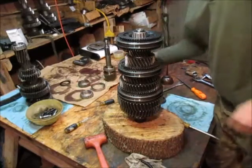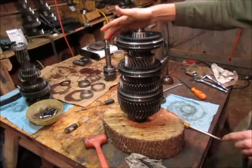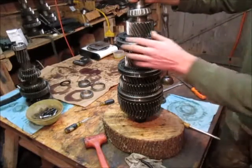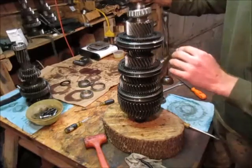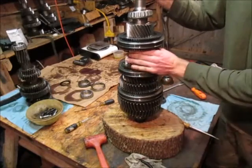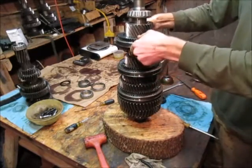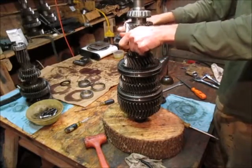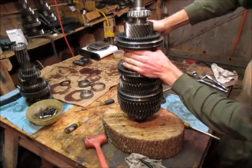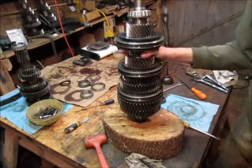Put the snap ring on - I'm not going to do that just yet because I want to look at it a little further on sixth, just to be able to look at it. But yeah, just throw the snap ring on. And then the input shaft goes on. I don't think there's any particular orientation as far as the input shaft goes. There we have it. And then it shifts good - shifted into sixth, good. Shifted into fifth, good. And then neutral. The synchronizer jammed a little there - there you go. That happens when it's sitting vertical.